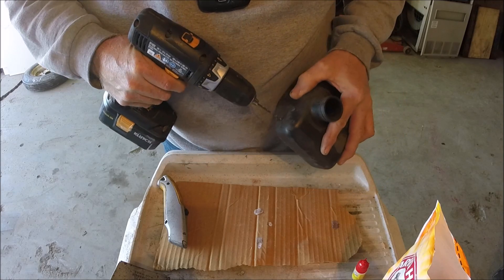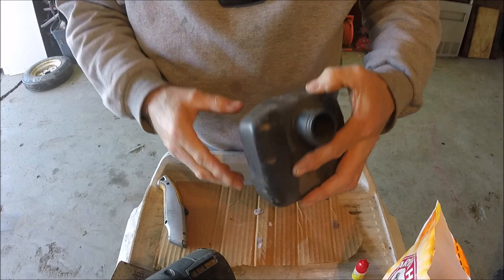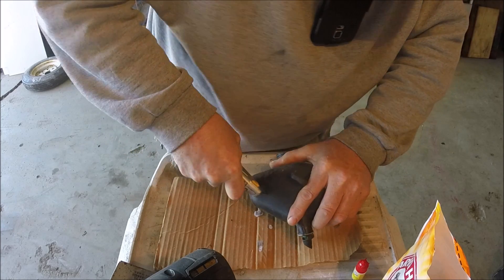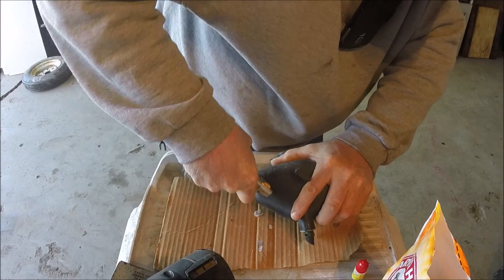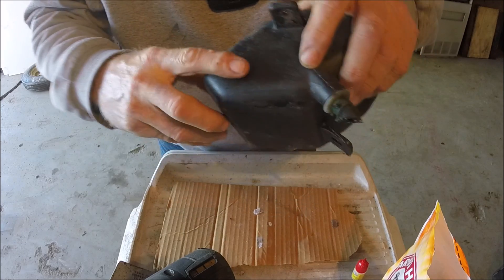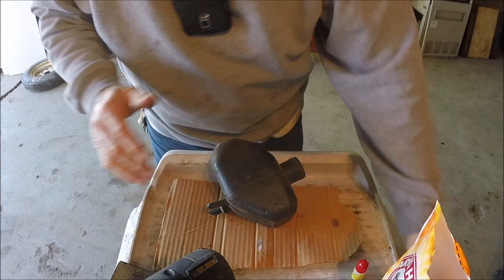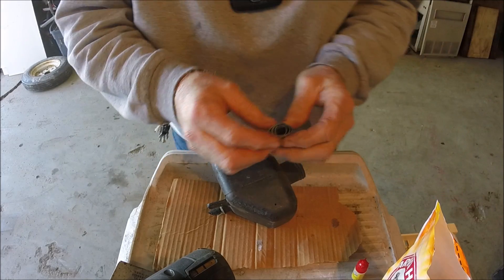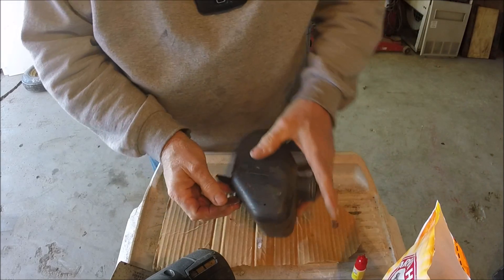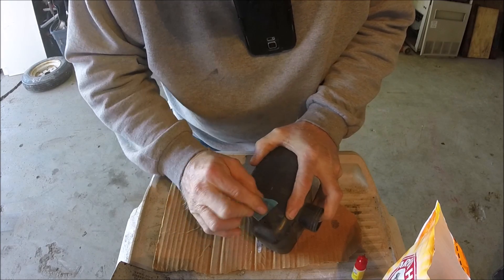You can see the hole. Now about the same spot on the other side, I'm going to cut a slice. See the slice? We're going to try both of those. As always, I use emery cloth — it's for plumbing, it's a good flexible sandpaper. We're going to clean up all around the hole.